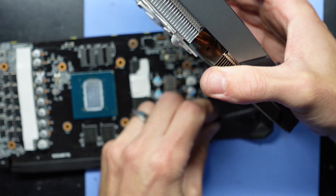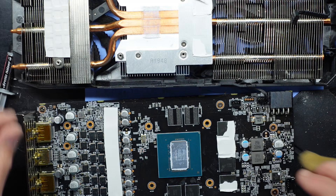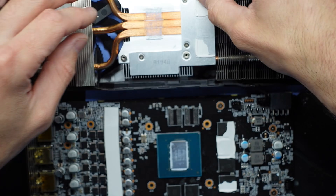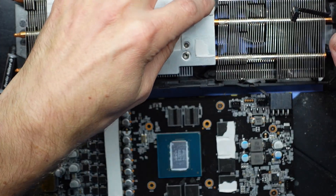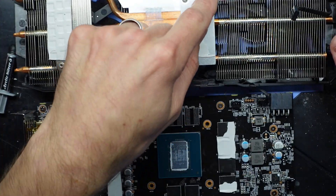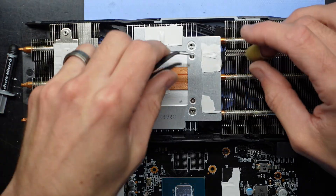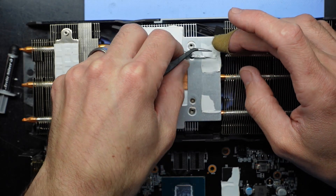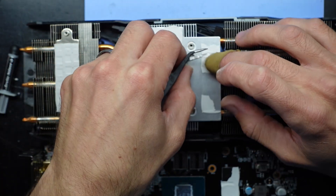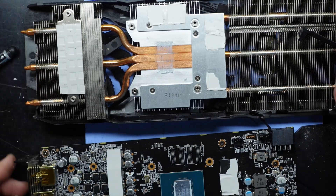Attached in here — wiggle that loose. With the twist we did risk damaging the thermal pad, but there's still plenty of thermal pad there to use so I'm happy with that. They still feel nice and squishy and slimy, which means they're still efficient, so I'll leave them in place.